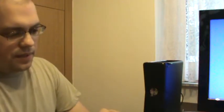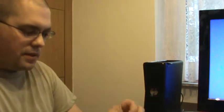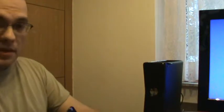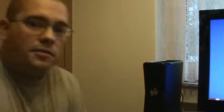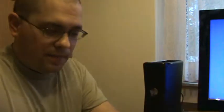Alright, lights off. Alright, now then, to go ahead and get this hard drive out, we just reach in, grab that tape whip, and pull it right out. Now then, let's say you've had your Xbox sitting like this with the tape whip on there and the old hard drive sitting in the new system for a good couple of weeks. And then, happy day, your new enclosure comes in.